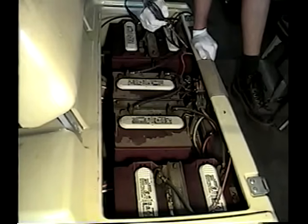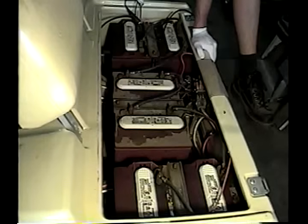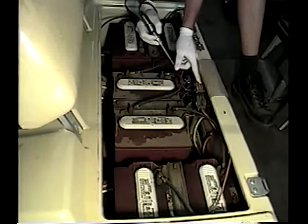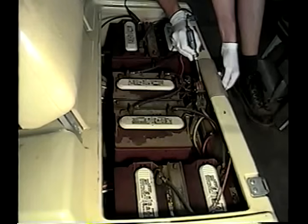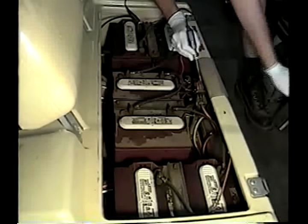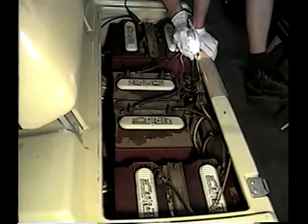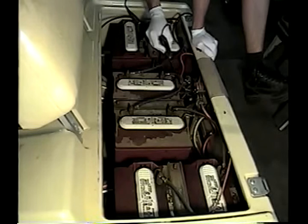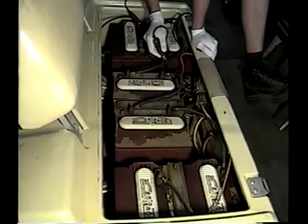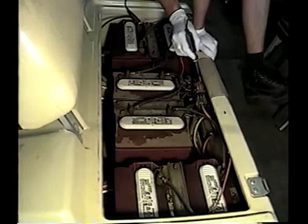It's very easy to test this system without pulling anything apart. Put your clip on the battery last negative, then probe the bottom contact on this first micro switch. You need to activate the micro switch, so put the car in forward or reverse, make sure your key switch is on, and step on the accelerator — you should get a light here. That tells us we're getting current into the micro switch on the multi-step potentiometer, out of that, into the key switch, out of the key switch, and into this micro switch.